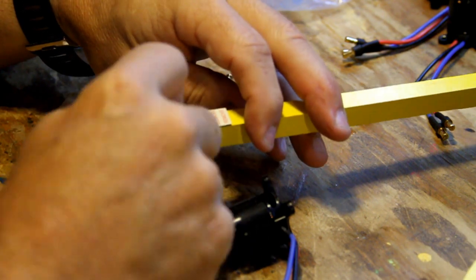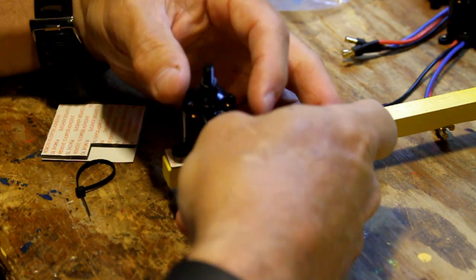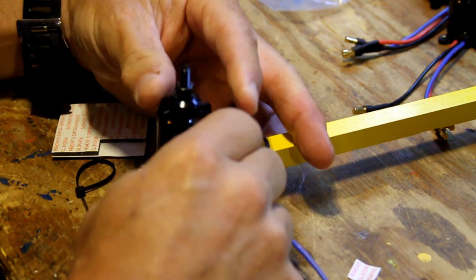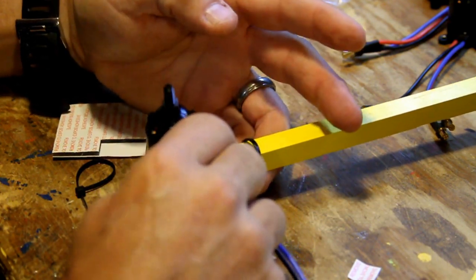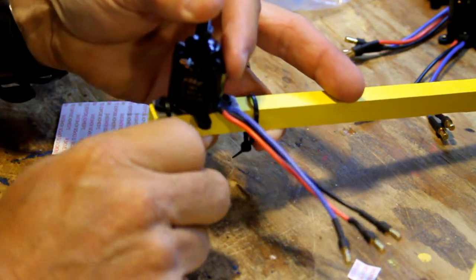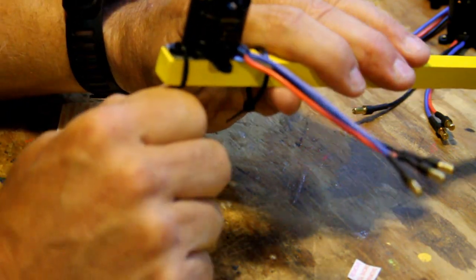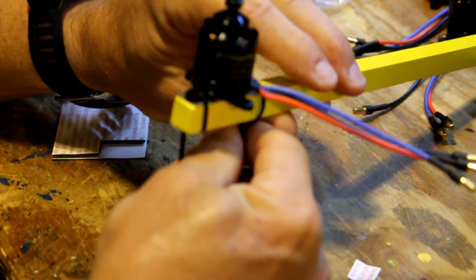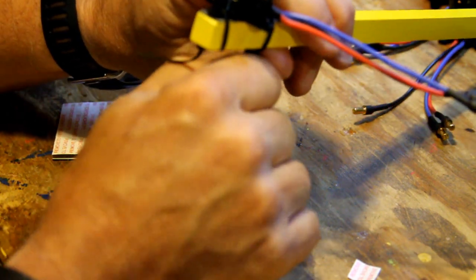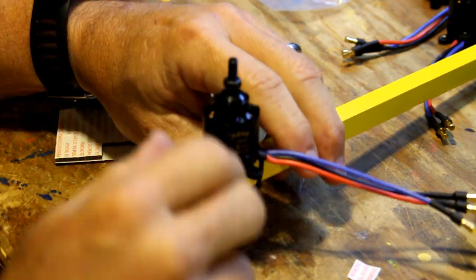That just keeps the motor nice and straight. If you put both zip ties on the same way the motor will have a bit of a tilt to it. The pad gives a little cushion to the motor so it has something to compress into when you pull the zip ties tight. Also useful is a zip tie gun — mine is still packed from an RC show. You can also use stronger 30-pound zip ties on here — these are 18-pounders — but for learning it's better if the motor comes off instead of stressing other parts.